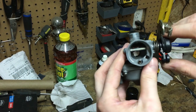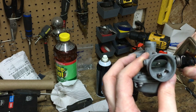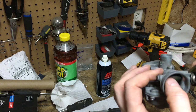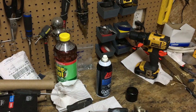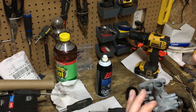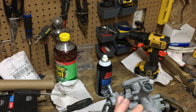One other thing I'm noticing with this carburetor is that the choke is kind of slow to move — it does feel a bit sticky. So I'm going to take this off for a moment and give it a quick clean with some carb cleaner to make sure it's clean, maybe hit it with a bit of light oil, and see if that fixes the stickiness. Then I'll go ahead and clean up the throttle cable slide and the needle slide, because that was really sticky when I took it apart, and then we should be ready to put this back on the bike and give it a test.